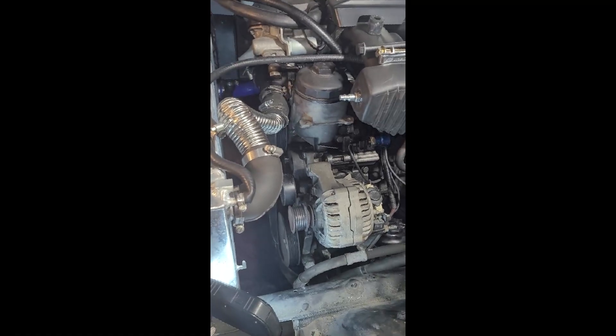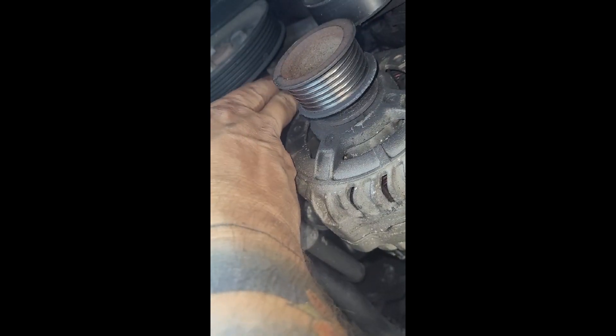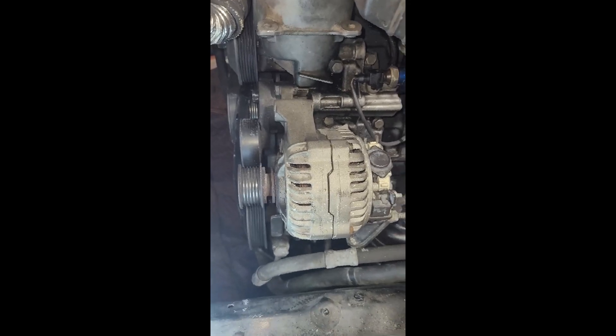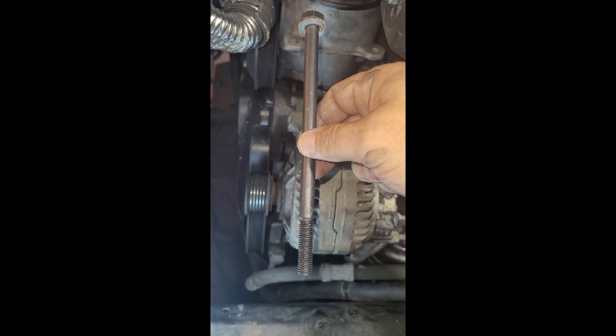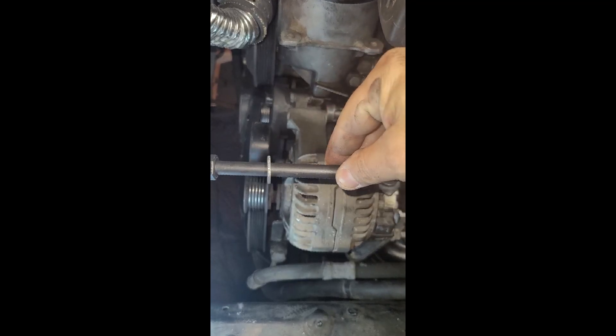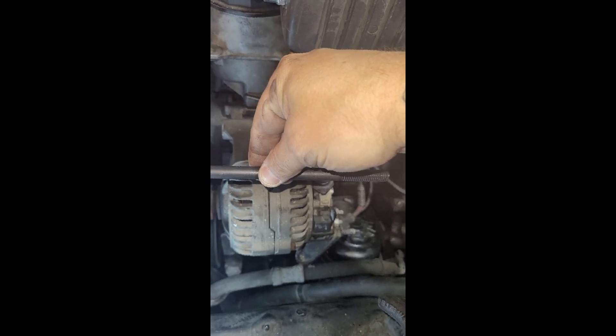In the instruction manual it's going to tell you to go ahead and pull your top and bottom alternator bolt. I've already done that. It's going to be this little bolt here and another bolt back behind this wheel. You'll see the other end of it right there rotating. So there's going to be another bolt down there - pull both of those out. Then you're going to replace them with longer bolts and spacers that are going to come in your kit. The bottom bolt is going to be this long boy right here. Make sure you get your washer on there first. It's a 180 millimeter black bolt. This is going to be your new alternator bottom bolt and eventually it's going to give you a place to mount the back bracket from the supercharger kit onto this bolt.